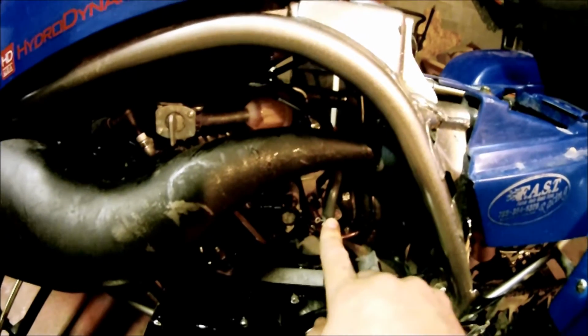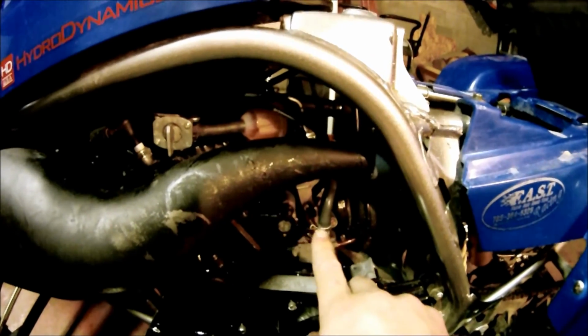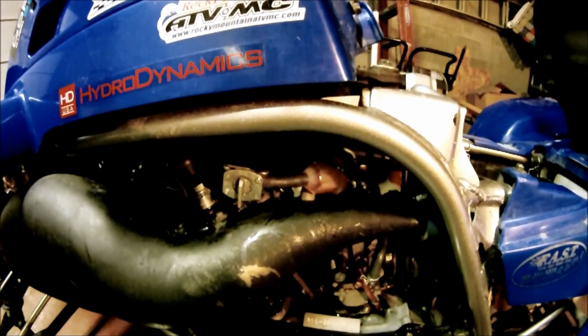Sliced the fuel tube in half, installed it, and then turned it on, and I actually just popped off the one fuel line right here just to get the air to bleed out, to get it to flow through. So I'm going to throw some zip ties on there and fire it up, make sure it works.